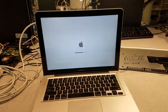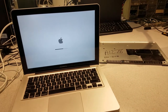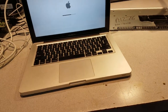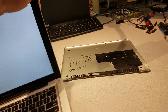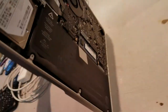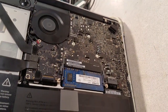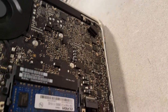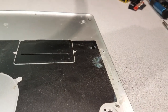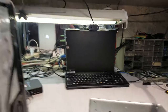This is Mike from Rockland County Computer Repair and we have an Apple A1278 that had water damage done to the motherboard, but we were able to repair it and get it up and going again. There were a couple traces that were corroded and actually one chip fried. We were able to replace it and get it up and going again.